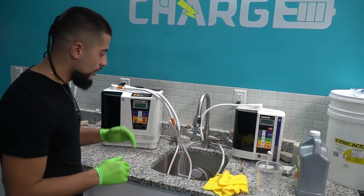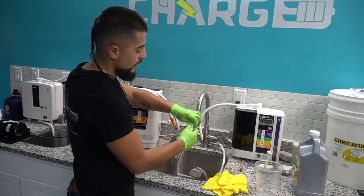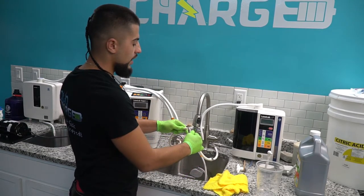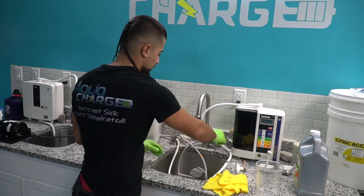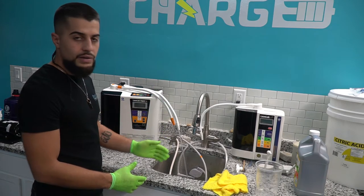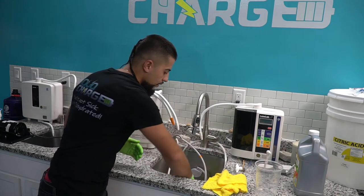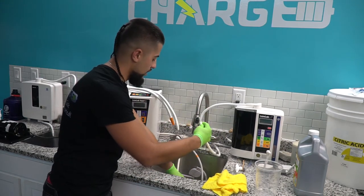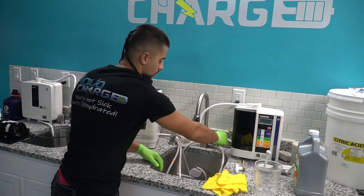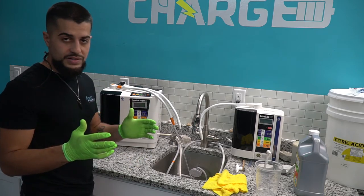The machine has been flushing for an hour. Stop the water, go to the quick connect, unhook it, and then unhook each acidic line. Now clean each side for five minutes individually. We're cleaning the Kangen water side — water comes in from the acidic hose and flows out directly. Do five minutes for each side. After five minutes, stop the water, unhook from the quick connect, let the hose drop, get the other acid hose, hook it up, turn it on, and now you're flushing the chamber for the hypochlorous acid water — the 2.5 and the 11.5 — for five more minutes.